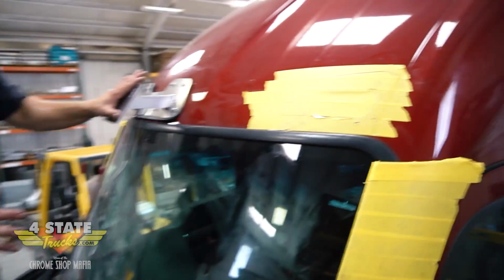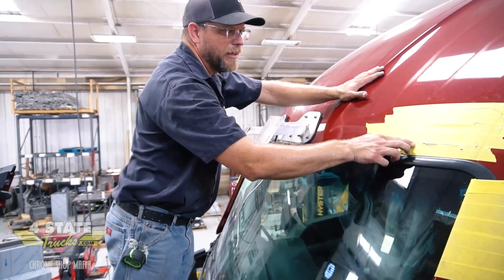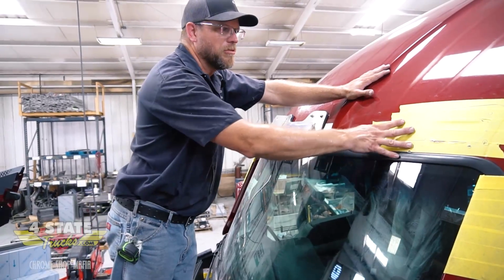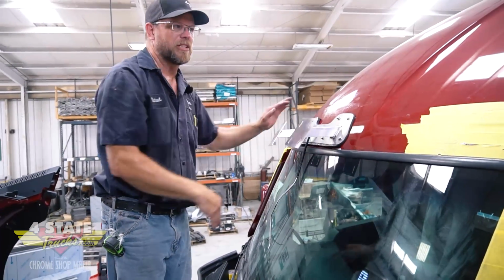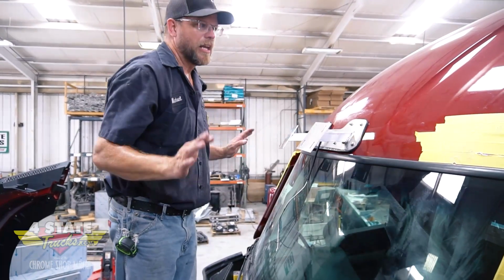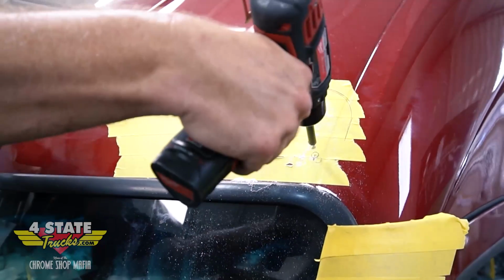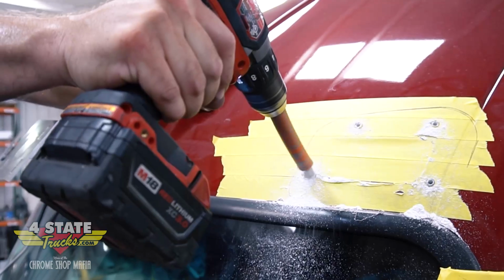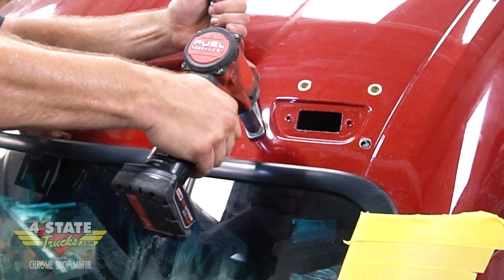This would get me equal height off the window and off the edge of the roof. Like I said, these brackets have a whole lot of adjustment in them. So this being higher by half an inch or so, I have no concern that it's not going to line up with anything. I've got so much adjustment in each piece, but this will get me even off the window, even off the side, and I should be able to get this right on here. So at this point, I'm going to drill a pilot hole through each of the 4 holes on each side, and then oversize it to my 17/32 and get a 5/16 nutsert put in each hole.